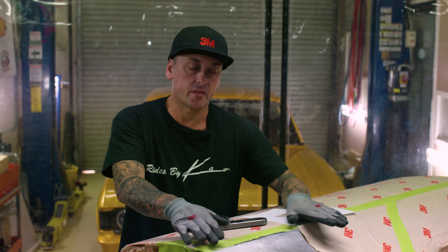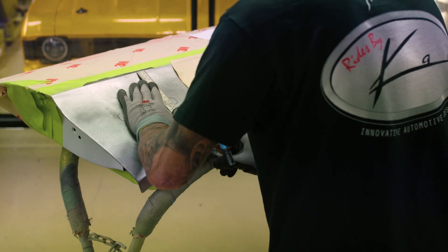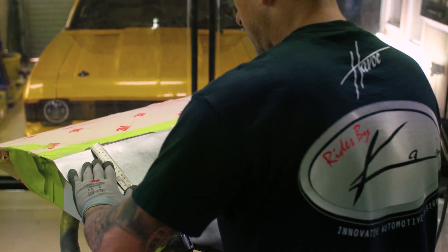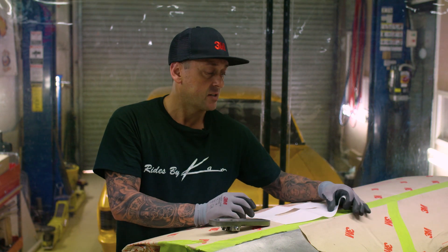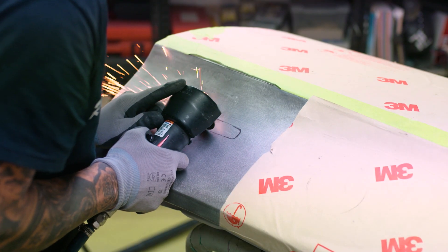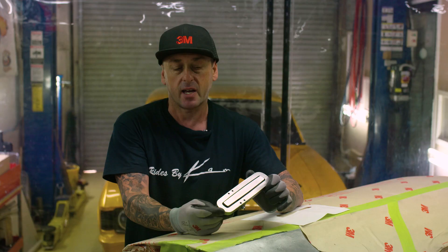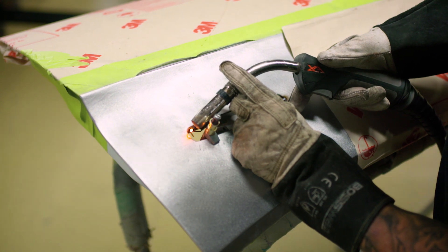Now that we've got the handle filled up and we've pretty much got a blank canvas to start with, we can start working out where to position our new flush fit door handle. There are a few things to consider — most importantly, how it's gonna line up with your striker that's inside the end of your door. The mechanism has to be in the right spot, and you also want to get it in a position close to where a factory door handle would look so it doesn't look odd. The next step is to get our template — that's our hole size that we need to cut in the actual door. We'll get that hole cut out, take the center section out of the door handle, insert it from the back, weld the back section of the handle in place, and then fine-tune it for the final flush fit fitment.